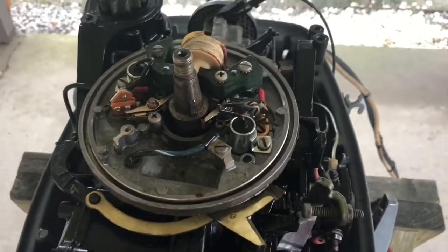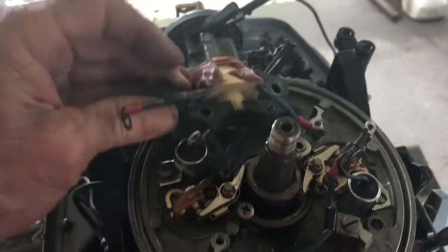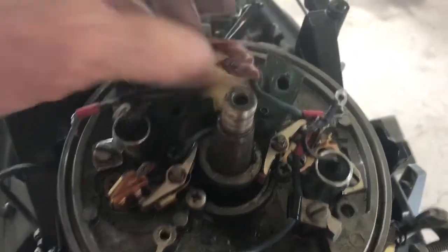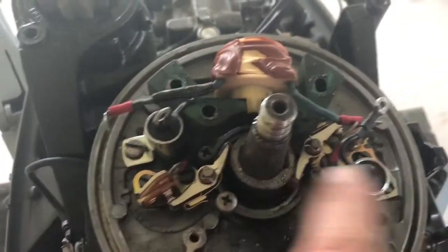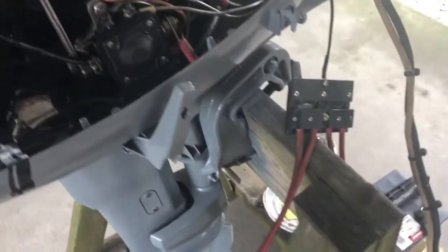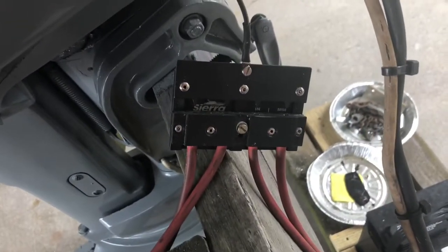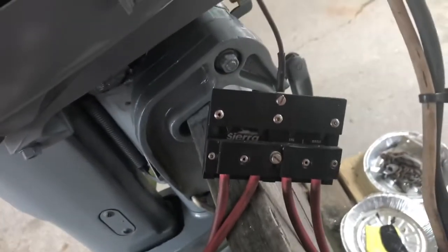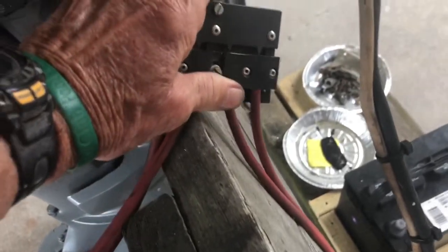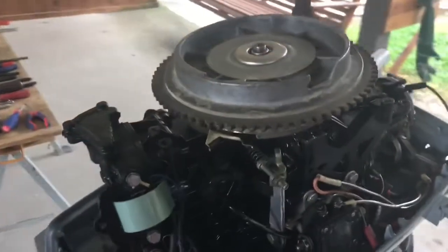I removed the three screws and I'm going to flip the coil over. That'll move the outputs to a different cylinder and see if I can move the trouble. I'll flip the coil over to make the outputs change and see if the trouble moved. Nope — still got no spark on the bottom. So I'm going to work on condensers and coils now to see if we can fix it.